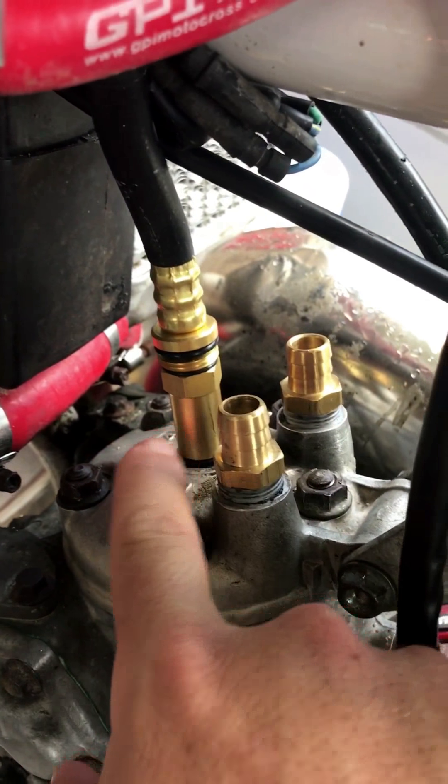The Innova comes with some adapters. The main line screws into the bottom piece, and then this screws into your cylinder head. You kick-start it, or if it's electric start you just turn the motor over until the pressure builds. I could only get this thing up to about 90 to 95 PSI. The top end is shot — it needs to be at around 150 PSI.